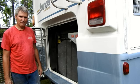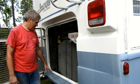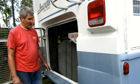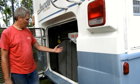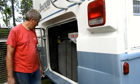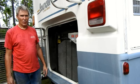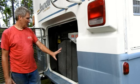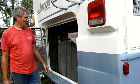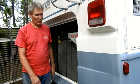So I did what I could, and if you can see down here the amount of junk that came out, it actually came through the radiator this way. A lot of debris, black stuff here, pretty ugly. Hopefully I sprayed out quite a bit. I went ahead and soaked this side again really well with Simple Green, and I'm going to spray this side down one more time.